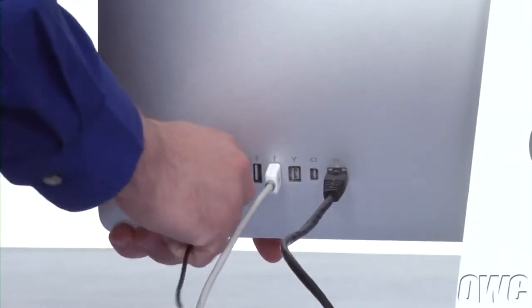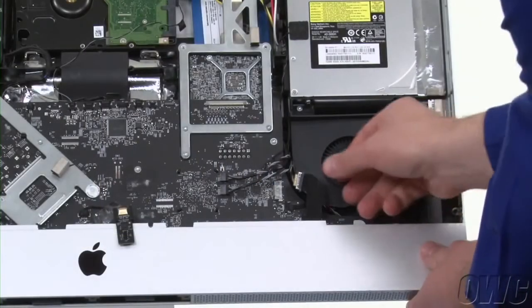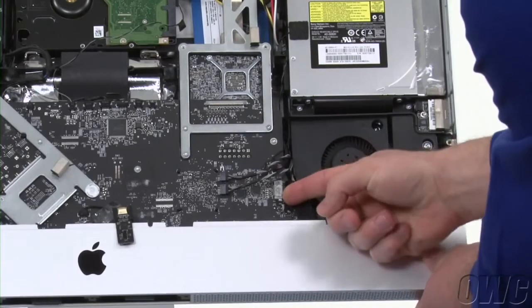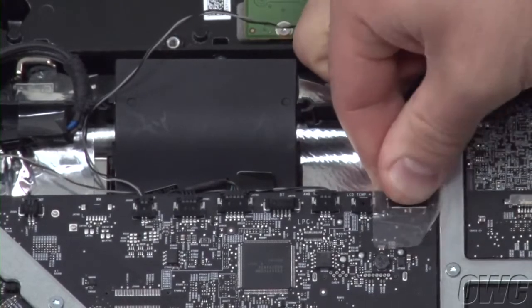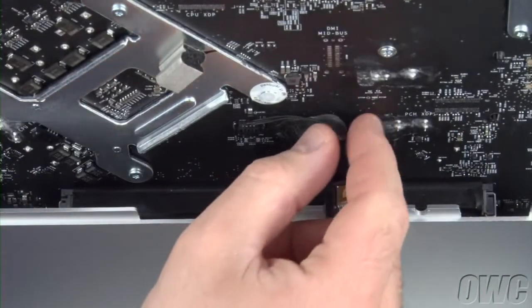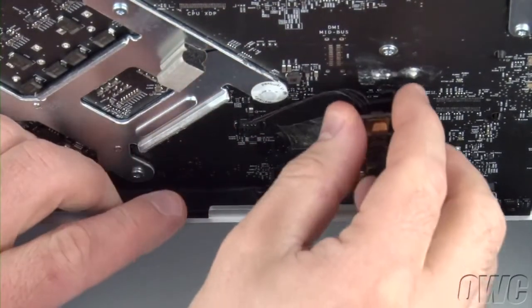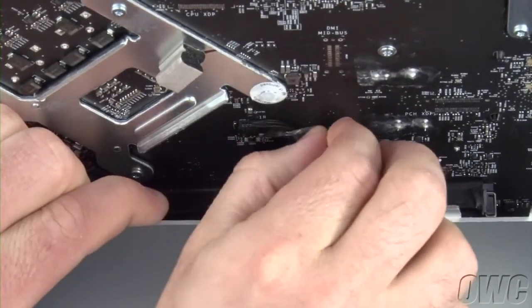You can then remove the cables from the back. If you unplugged it earlier, reattach the audio connector cable by aligning the connector with the port and sliding it in until it clicks. Next, reattach the AirPort cable by aligning the connector to its socket, pressing them together, and using the tape to hold it in place. Next, peel back the tape holding the IR sensor in place, slide the sensor down over the bracket behind the Apple logo, then use the tape to hold the cable in place.